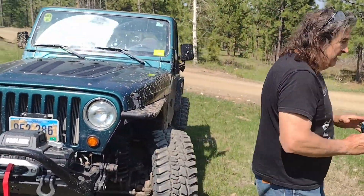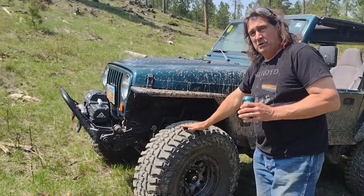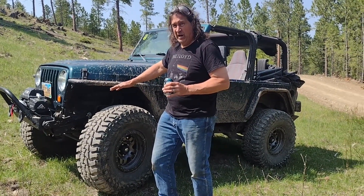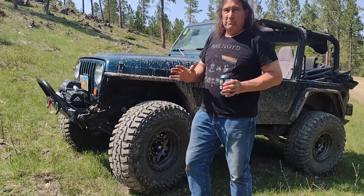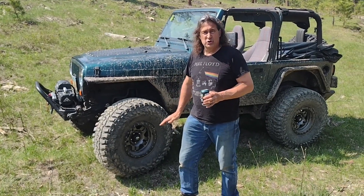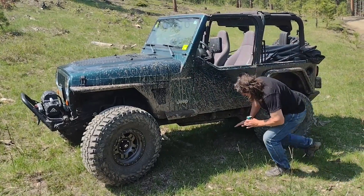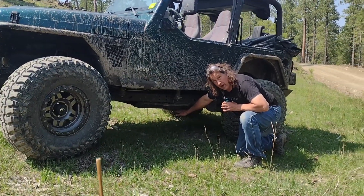The next most important thing is going to be oversized tires. You can go bigger than stock without putting a lift, but not by very much. And you don't want to get too crazy because you don't want to stuff your fenders and cause body damage with your own tires. But if you're really wanting to get crazy — and some people will argue this is not true, other people will say it is — lift kit. You'll find guys that say the only true additional ground clearance you're going to gain is from bigger tires. That is not entirely true, because a lift kit will raise the entire frame and body of your Jeep and will give you more ground clearance in this area to keep from getting high centered on your skid plates.